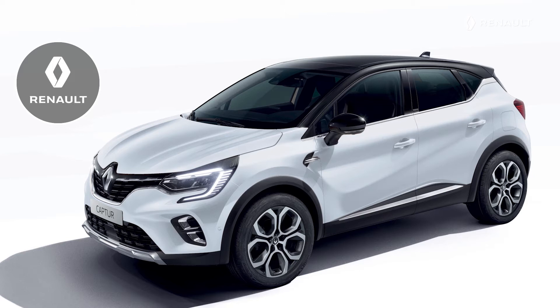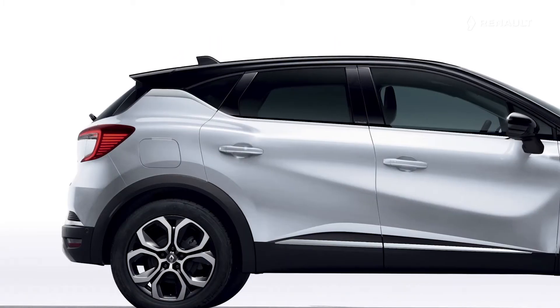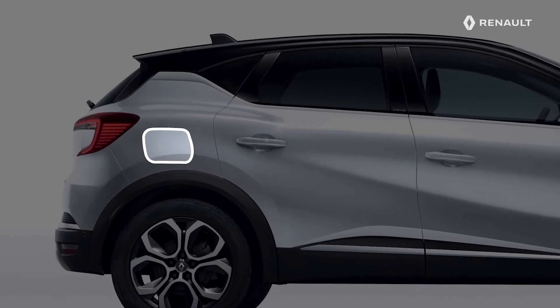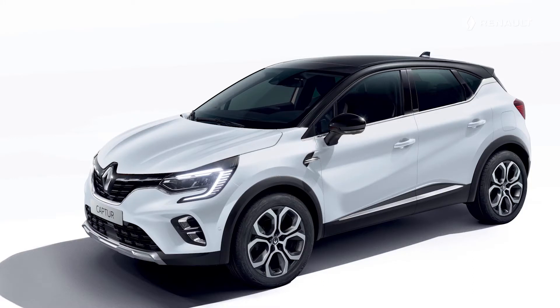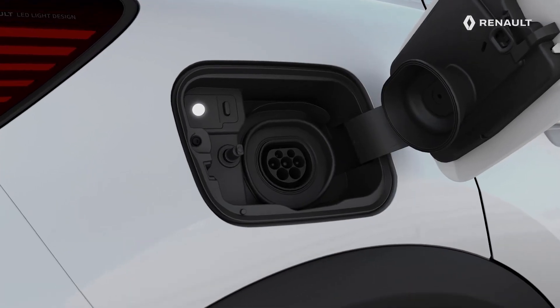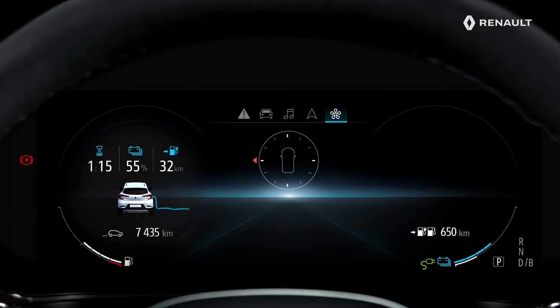Take the charging lead out of the vehicle boot. Unlock the vehicle and open the flap located on the right rear wing of the new Renault Captur E-Tech plug-in hybrid. This indicator light is on in white. With the vehicle stationary, immobilized, and the ignition off, plug the lead into the power supply, then connect the lead to your vehicle holding it by the handle. The indicator light flashes yellow. A locking click indicates that the lead is automatically locked to the vehicle. When charging starts, this indicator light flashes blue.